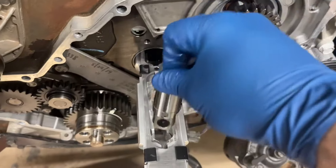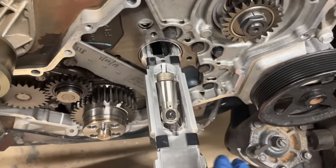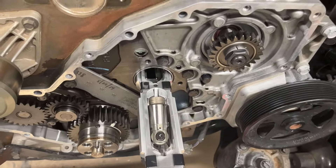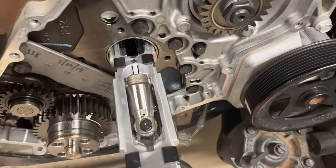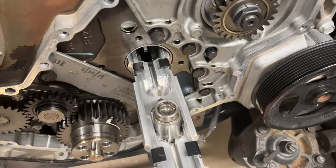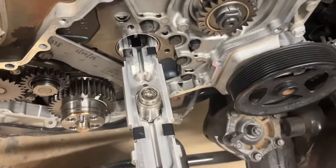For intake, which is in the front, keep the keyway towards the cold side of the engine, get it in the notch, and lay it down. Do that with every single one in that orientation — notch towards the cold side. Secure the block leaving about a centimeter like before, then pull on the handle to lift the lifters up. Push the handle back in and push again to seat them, then put your pin in.